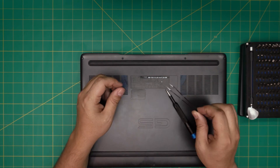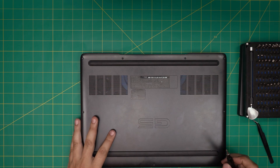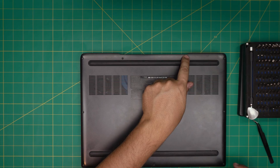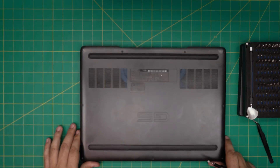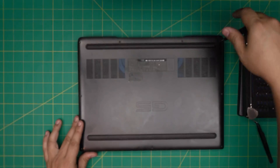With all tools on hand, we're going to remove all the screws on the bottom cover except the two mid-back ones — those have a C-lock that prevents the screw from coming out entirely. Start from corner to corner, remove everything including the front ones, and keep them in one pile as they are all the same size and height.